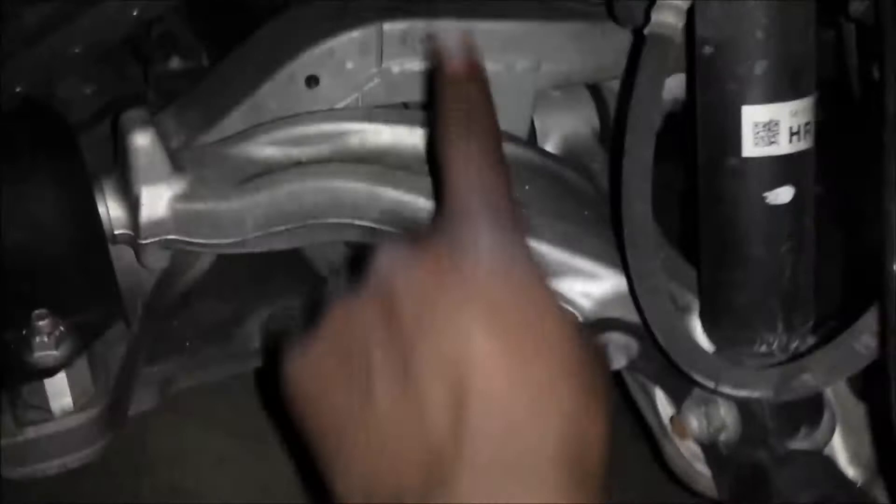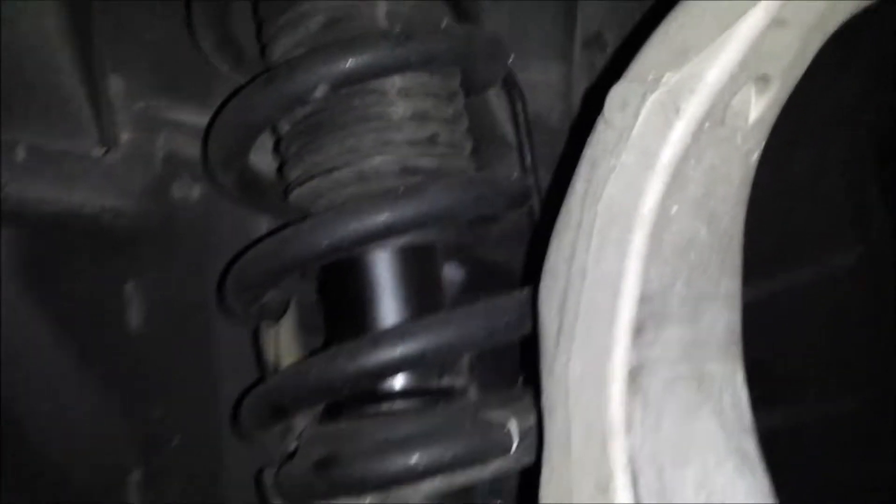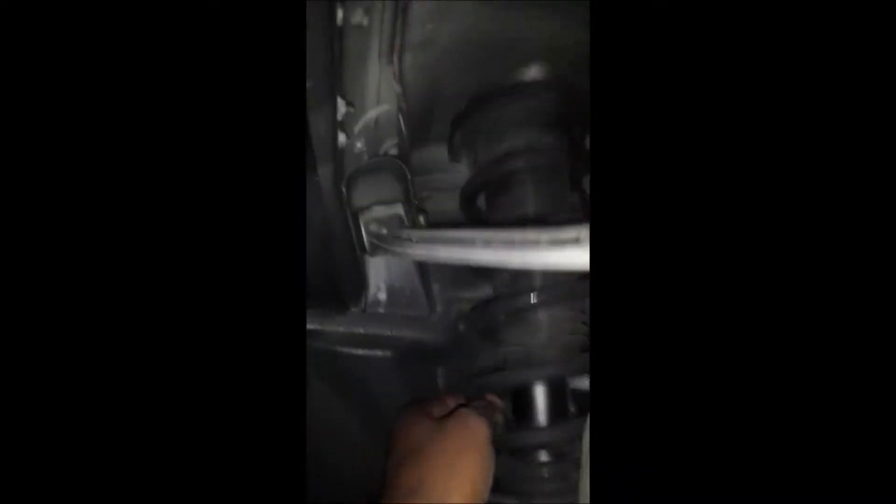When it comes to suspension, things look very familiar on this car. It looks a lot like the 2008 M45 — you've got double wishbone suspension with an upper wishbone, a lower control arm, and a strut and coil spring combination unit that goes through the body with three bolts. These are the sport ones, described as double-damped or something similar.